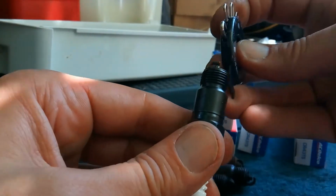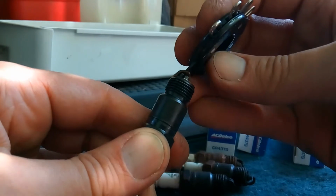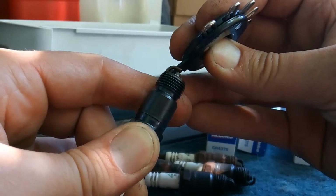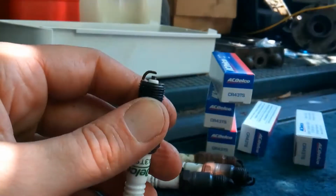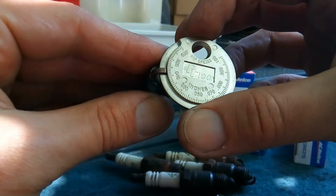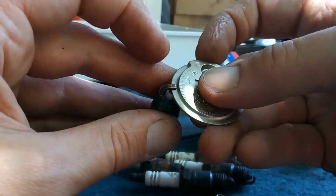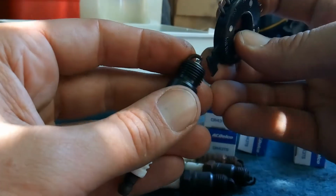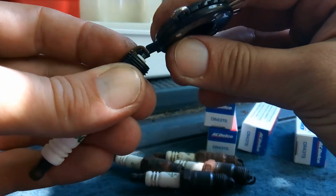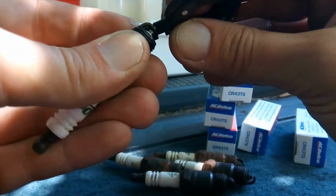So I figured out how to use this tool properly. You take this corner here, you slide it, and then you've got to just slightly tweak it, because if you do it too much, then you've got to go back and forth. So it took me a while for each of these spark plugs to get done. Okay. Oh man, wow, see, practice makes better. Not quite. I guess I could tweak it just a little bit more just to get it to match the other spark plugs just right. So let's see here. I'm holding my breath.